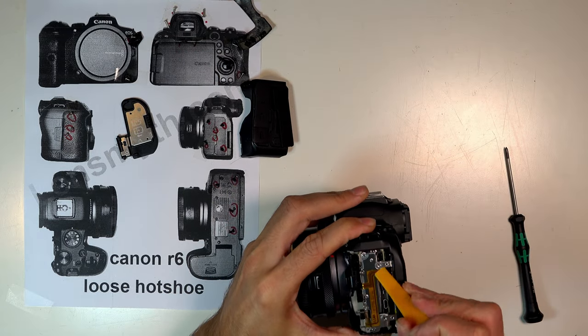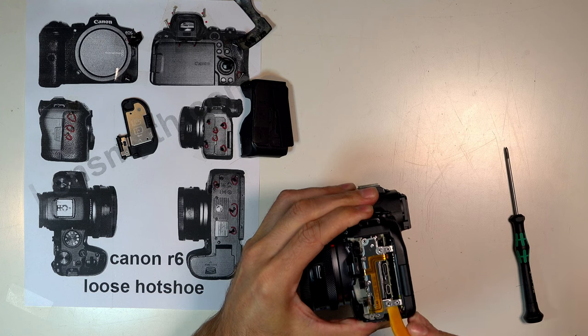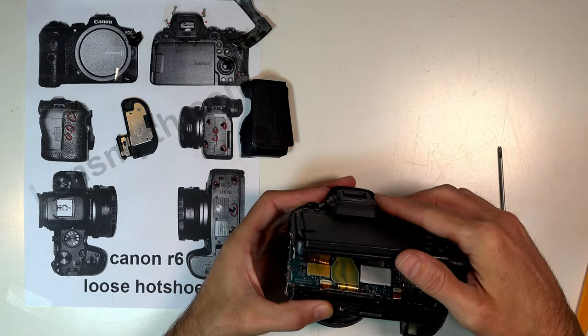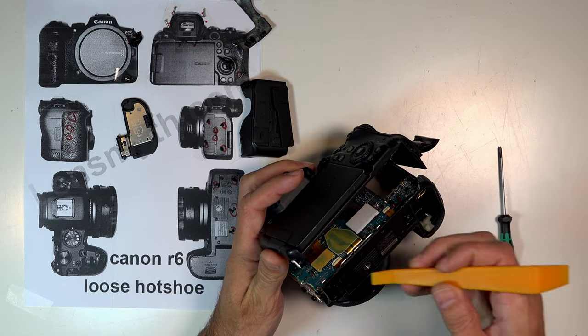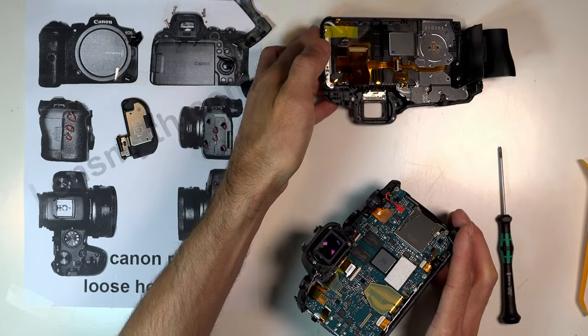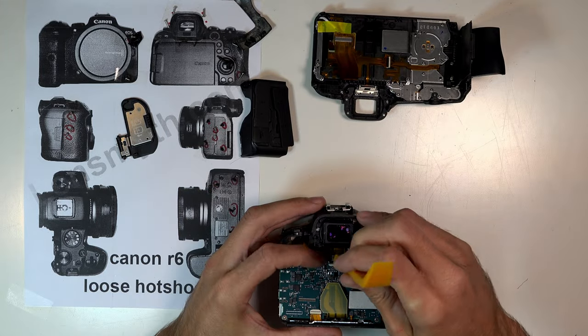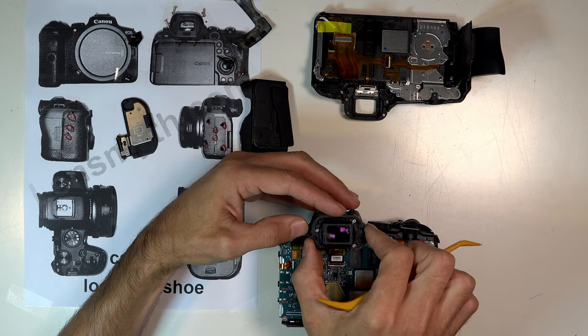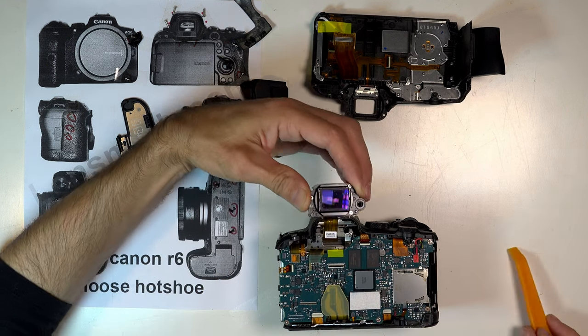With a slight pry, the port cover comes off — there's no wires connected to it. Under here, there's two more screws that hold on the back. Another small pry to release the two latches and the back starts to come off. It helped me to pry a bit here to loosen it first. The flex cable must be removed by gently prying it up with a plastic flat tool. The viewfinder cable is more delicate, and the black clasp folds up. To release it, pull the cable out slightly to disconnect it, and then the viewfinder is free.